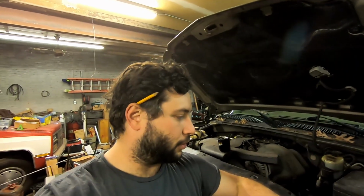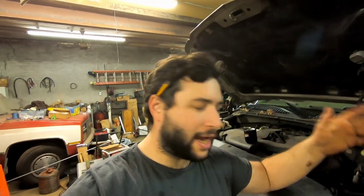There's a bunch of different versions. I just picked this one up. There's no specific rhyme or reason. Cut your oil filter open, and then you'll actually look at the filter itself. And we'll go over it with this thing. But it's super crucial. It's super inexpensive to just check the health of your engine.